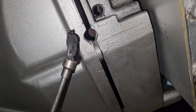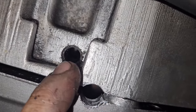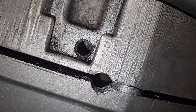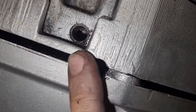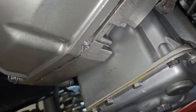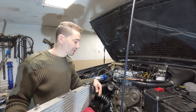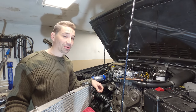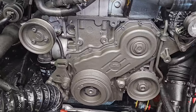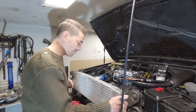For those of you wondering why I just did that — there's a hole on the flywheel that you normally use a special tool to lock it in place to tighten the harmonic balancer. I used a drill bit and it snapped, so I drilled it out and got it out. It's all back together and I've given it 24 hours to cure, just to make sure — because of the way that seal went in and the sealant around it I just want to make sure that's fully dry before I introduce oil to the system. I've also given it a healthy coat of paint and I'm going to put the intercooler back on before I start it up, because I really want it connected to the air filter.